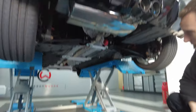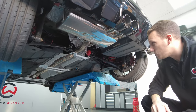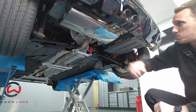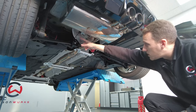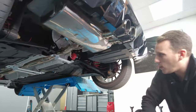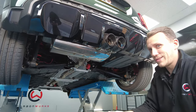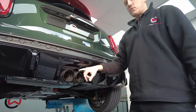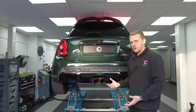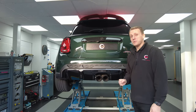A little bit dirty but gives you an idea of what it looks like underneath. This is a cat-back system, so right at the front end there you've got this nice chunky resonator which takes away a lot of that droniness you'd normally hear. That's pretty much straight through all the way to this great big chrome rear muffler silencer, which is very clever in the way it valves. You've got the valve system and solenoid here, and this is a branch-off pipe to effectively make the noise come out of one pipe rather than the other to give you some different notes. It's a lovely bit of kit - it fits really well, which was fantastic. I've opted to go for carbon fibre tips, and then I've gone another step custom with a diamond black finished tailpipe tip, because personally I prefer black. You guys are going to hear it - enjoy it - and if you get an opportunity to like and subscribe it'll be really appreciated. See you guys next time.